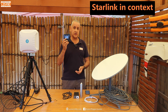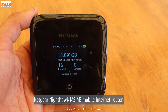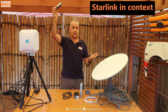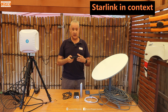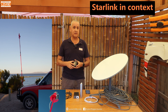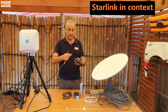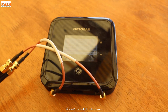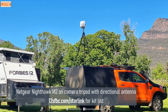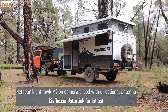That's when something like a dedicated Wi-Fi router modem can start to be useful. This is a Netgear Nighthawk — I can charge it and it will last for an entire day on battery power. The Wi-Fi range is pretty good and you can raise it up high, which helps since the higher you have anything talking radio waves like a 4G access system, the better coverage you'll get. You can also connect it to an external directional antenna, point it toward the signal source, and hoist it further up — on a camera tripod, a pole, or whatever. But it does require you to be vaguely within range of a cellular signal.